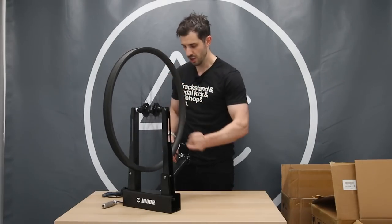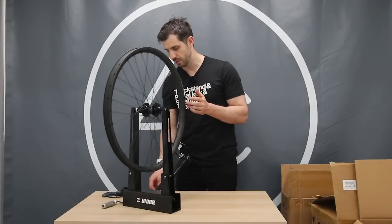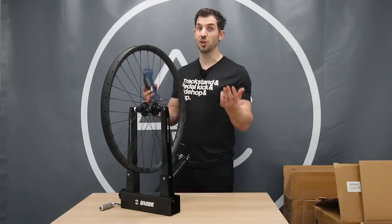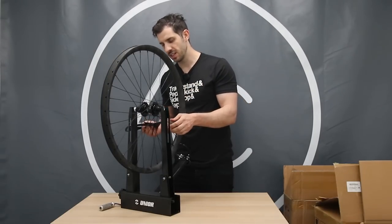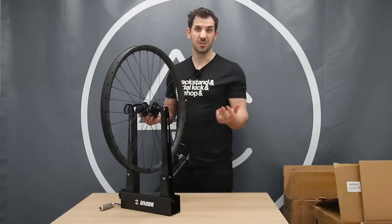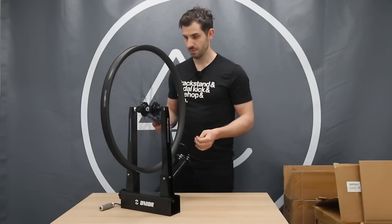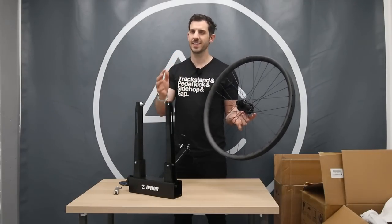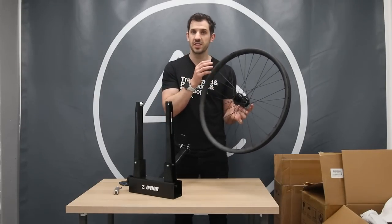I'll be happy to stick that on my bike and give it a ride. Let's just see what these tensions are like — I suspect they might be slightly different now, but it's always a compromise. There's not much change at all. There's maybe one that's slightly out that if I was being picky I'd add slightly more tension to, but it's not vital. This will be more than suitable to be fitted to a bike and absolutely punished. I'm happy with that. Just like the 26 inch wheels, I'm not going to do anything with the front one.